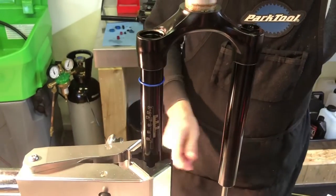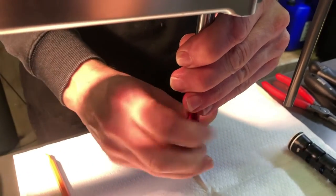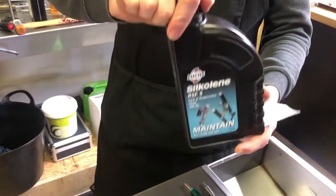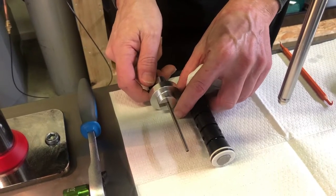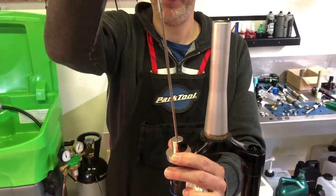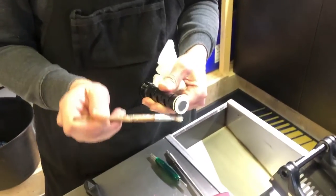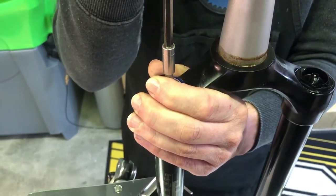Before we put fresh suspension fluid into the damper, use the rebound adjuster to open up the damper — turn the rebound adjuster clockwise from the perspective of the rider to do so. Place suspension oil into the damper stanchion; we use Silcolene RSF5 suspension fluid. Pump the damper shaft a number of times so the air moves out. Set the oil level gauge at the length of the compression damper minus about half an inch — this way, when extracting the excess suspension fluid, you'll know the entire compression damper will be submerged. Place the new o-rings on the compression damper, lubricate them with suspension grease, and insert the compression damper and tighten it using the 24mm top cap socket. Reinstall the compression adjuster knob.